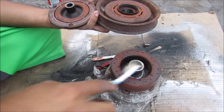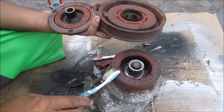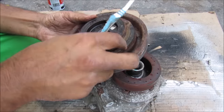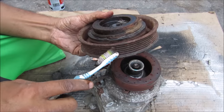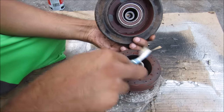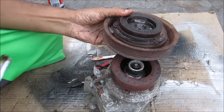Here you can see the electromagnet which is powered by this wiring harness over here. This electromagnet does not need to rotate. That's because you've got your armature here that will actually sandwich itself to this free spinning pulley to rotate together as an assembly, as the electromagnetic force from here sucks it through the free spinning pulley and together into a sandwich.